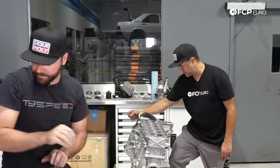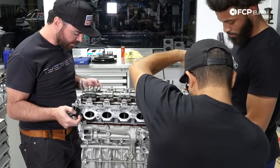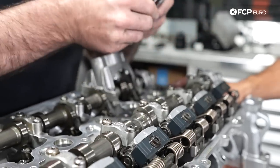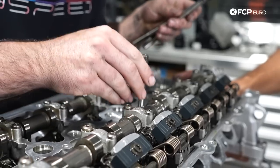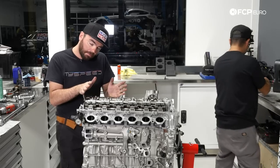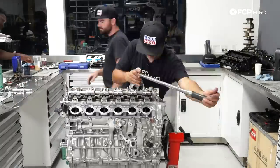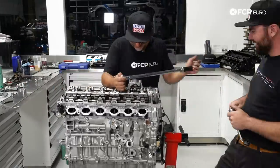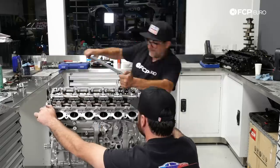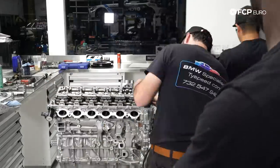We've installed the head gasket and the cylinder head is cleaned up with the surface prepped and old gasket material removed. We've installed the ARP 625 head studs and Michael is laying in the head bolt washers, after which we'll torque the head down. After that we need to run the timing chains and bolt on the external accessories before potentially putting it back in the car. The cylinder head assembly is an extremely important piece carrying the valves and camshafts, and torquing the head to the block requires each nut to be torqued in a specific sequence multiple times for a proper head gasket seal.